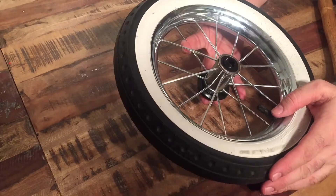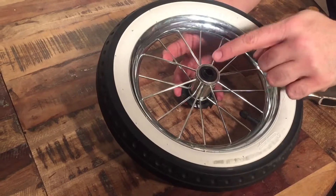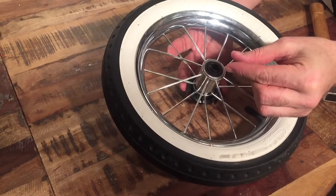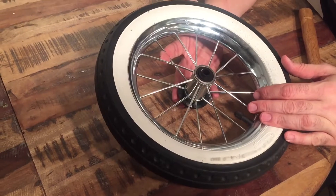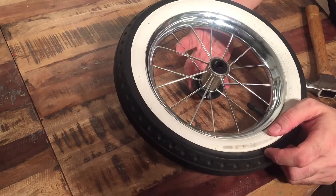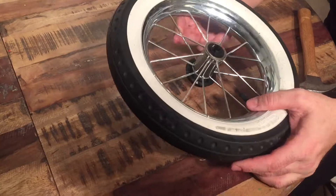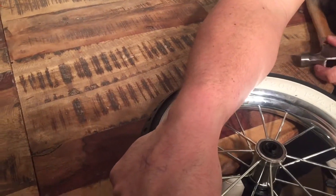In order to remove this, I have found the easiest way to be to actually hammer it carefully such that these two pieces compress in towards each other and go down into the central ring. If you have a wheel that you've used for a while, you'd certainly want to lubricate it a bit first — some WD-40 would be ideal. You want to be careful with the hammering as well; it is possible to break these pieces — and this is my disclaimer.